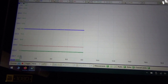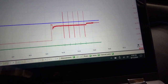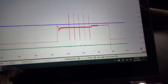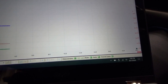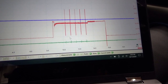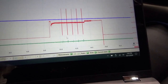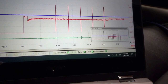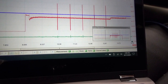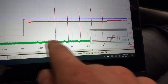Three channels. Let's crank it. Nothing at all on our pressure transducer — not even one PSI, which is crazy. Something's definitely wrong with cylinder number two. Moving to a different cylinder — let's bump up the scale. We see tiny little changes there.